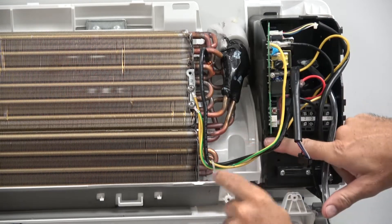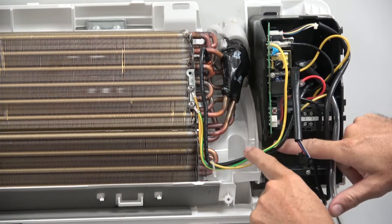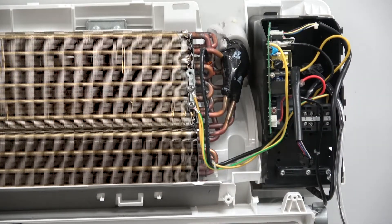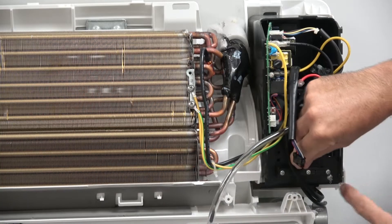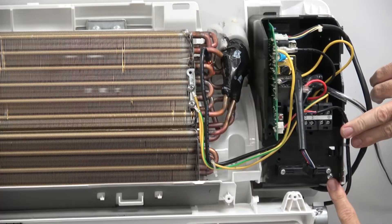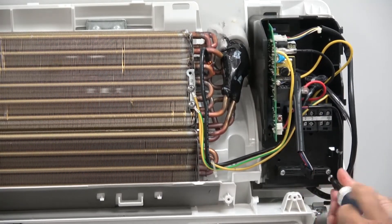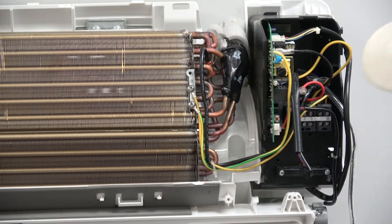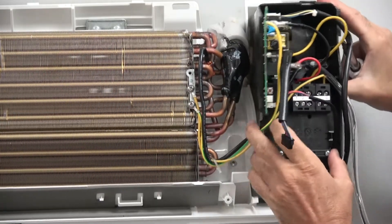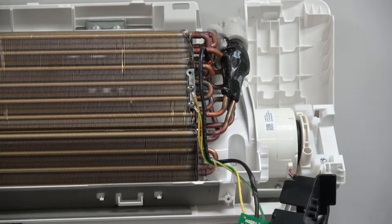If your wires are hanging over here, your zip tie is not correct, or if you don't put the zip tie back on, water can actually overshoot off the drain pan. So put your wires back in, and to remove the assembly, you have one screw down here on the bottom. Down at the bottom here, you take the screw — remove that one Phillips head screw — and simply lift up on the assembly. It will come out of the lock at the top and the whole assembly is removed.